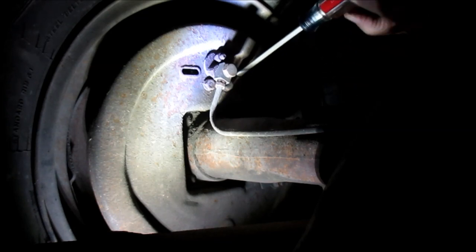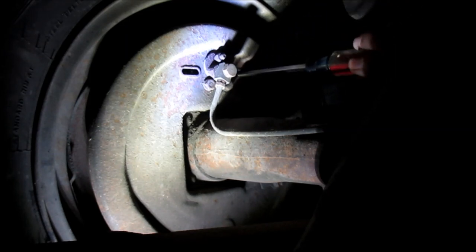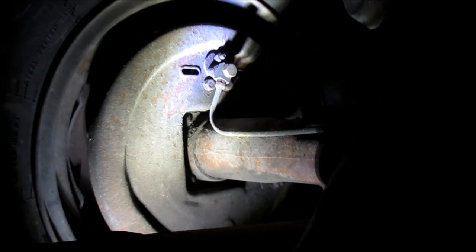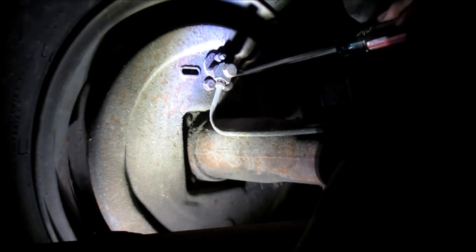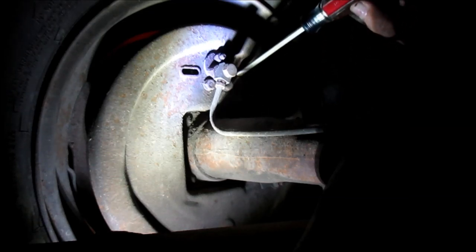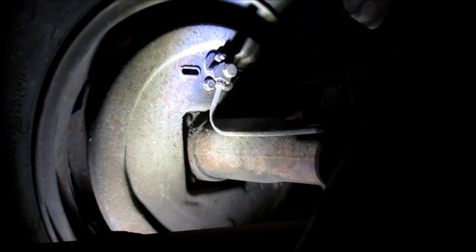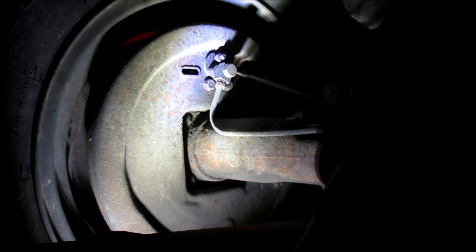I've got the correct tool, but I find that the screwdriver works better. All right. Now the book says to turn it till it can't turn, then back it off to where you can spin it. So that's what I'm going to do, because it's hard to gauge drag when you're turning the gear, the gear and the torque tube and all that other good stuff. I'd say that's making good contact. Now I'm gonna back him off a little.